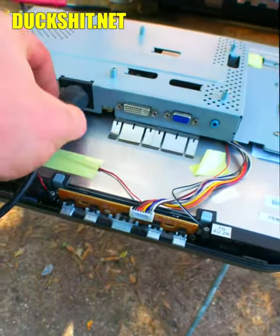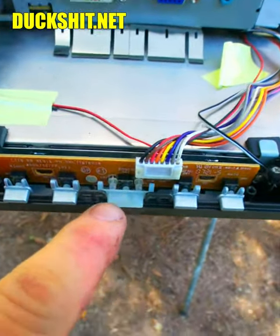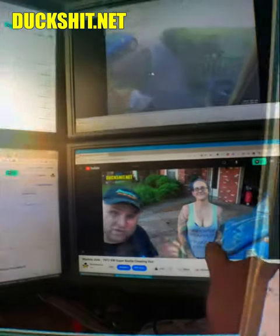Let's go ahead and start putting this monitor together and see what happens. Plug our power in here. Turn this on. We're looking for the power light — it should light up green and stay green. So far, so good. By now it would have turned orange. There it is — no signal, but it's lit up like it's supposed to be. This monitor's repaired. Let's reinstall it.